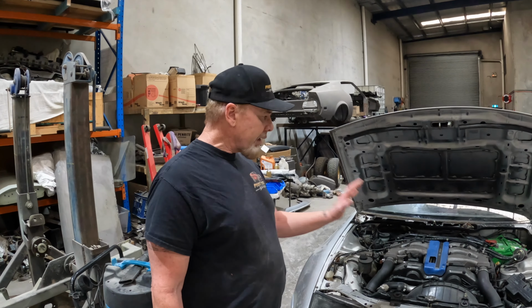And I think what I might do is jump in and install the cross member for the four-link, and that basically gets held in by some self-tapping bolts, believe it or not. I'm probably not going to settle for that. I'll go ahead and put the bolts in, as well as some little one-inch welds around it. It's a pretty snug fit. Not snug, it's tight. So I'm probably going to need to get the Porta Power and just jack it apart, the 3 or 4 mil that it needs to get it in.